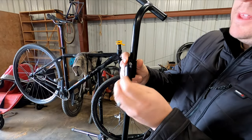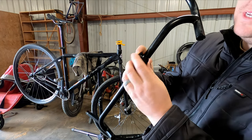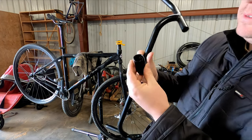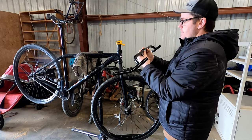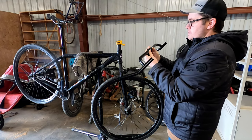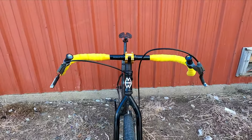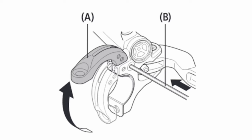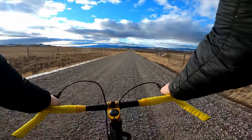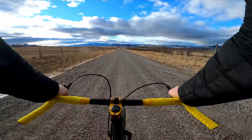So if I was in charge of redesigning these bars, what would I change? While only a minor inconvenience, the first thing I'd do is remove the need for shims with a 31.8 millimeter stem — I don't know the last time I used or even saw someone with a 25.4 millimeter stem, so let's bring this bar up to modern standards. The second thing I'd do is extend the hoods an inch or two. Right now they're just short enough to not be worth the hassle of taping. If they were a little longer, I'd probably put bar tape on them and leave enough space for a brake and shift mount that can be fully opened to clamp on and off. That would solve two problems: it'd make the hoods a comfortable place to put your hands, and it'd allow me to swap bars without wasting material.